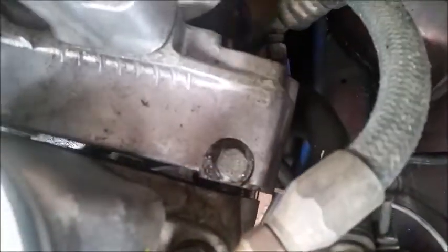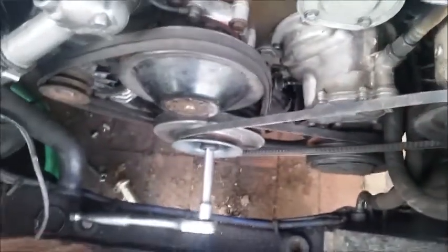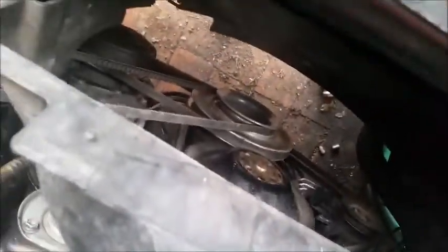It's time to tighten it up on the back. I've got the fan in and the condenser in for the air conditioning. After you've tightened up all the belts except for this one, put the shroud in, and that's when you put the fan in — that's what holds it in place. I recommend you do not tighten up the alternator until you have got the fan in place. A good tip is to just half-screw in the bottom bolt and do it at 12, 6, 3, and 9 o'clock so they line up and you've got a resting platform while you get the rest in.